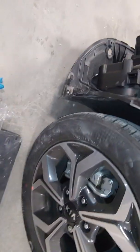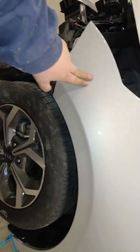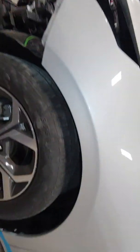Hey guys, this is Ollie in the body shop. I have a Kia Forte here, replacing the fender. This is the new OEM fender — trying to line up my gaps on it, checking hood gaps. The door is a blend, but as a blend there's no front end damage. The liner is getting replaced; I'm just using it for the test fit on the fender. Just working late tonight checking gaps — I don't like how tight this gap is.